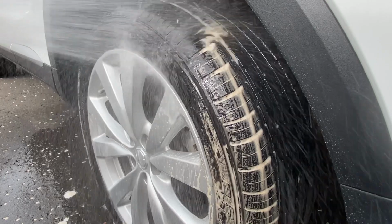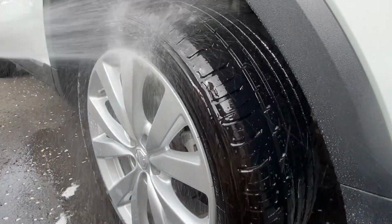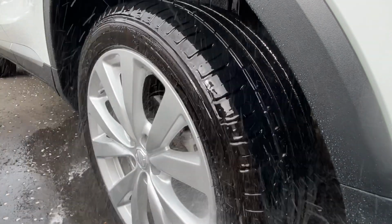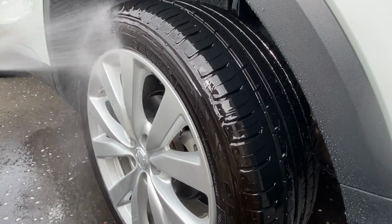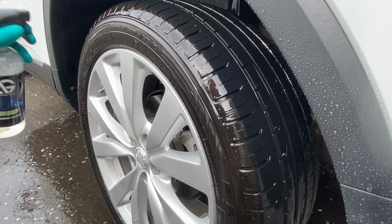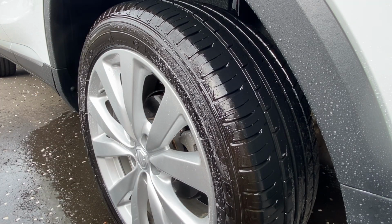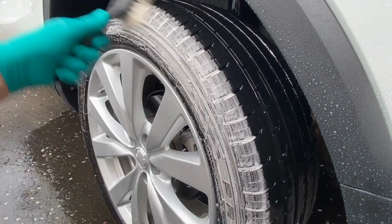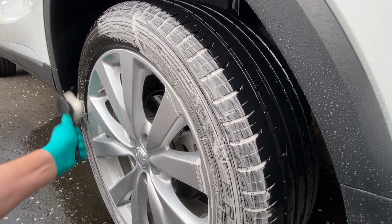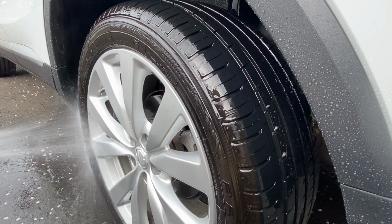Just a quick note, however, that tyre manufacturers generally don't recommend that you use harsh chemicals too often on the sidewalls of your tyres, in much the same way that you wouldn't use an exfoliator every time you wash your face. Now, I'm fairly confident that Rebound will have cleaned the tyres thoroughly with just one go. It very rarely takes more than one. Agitating the foam, it's nice and white, which generally means the tyres are clean enough for a dressing.